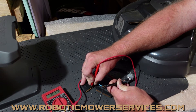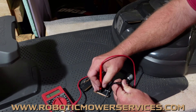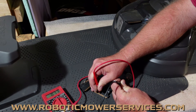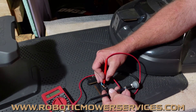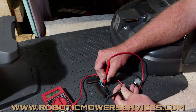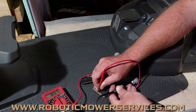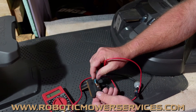The side with the brown wire is, if you can get in there just right, actually good. But you come over to the side with the blue one and it's got all this plastic melted to it because it got hot because of all the high resistance — and you can see we're at 7 ohms of resistance. This is a bad one. This one would fail, and if you get that, your next step would be to come here to this terminal that's crimped onto the end of the wire — and you can see there we're good. So from the connector to the end of the wire we're good, but it's between the end of the wire and the plate itself where we have the high resistance, and that's why we'd want to take this screw out and clean everything up.